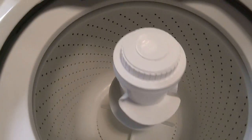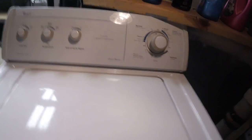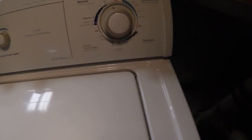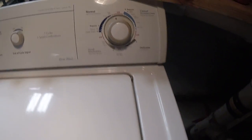There are two problems with this machine. I've already run it once just to see if everything was working, which it was except for these two things. One: when the lid is open and it's in the cycle, the lid presses up against the timer knob and will push it in a little bit, so the machine will start and stop, start and stop. I'm pretty sure that's not good for it. With just the lid, I can push the timer knob in — I pulled it out, and now it's pushed in.